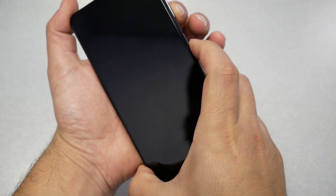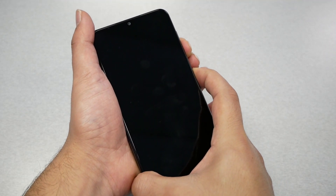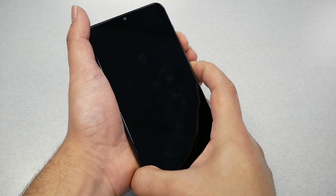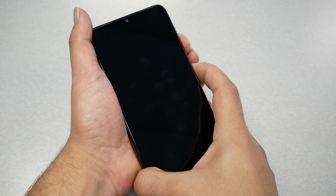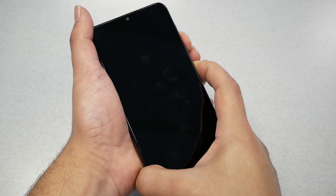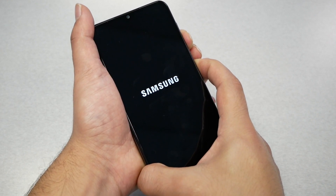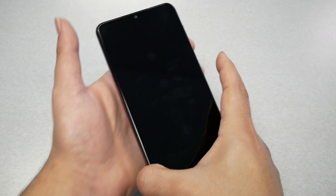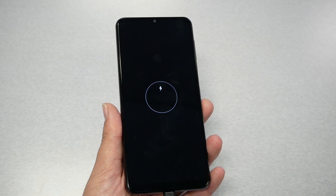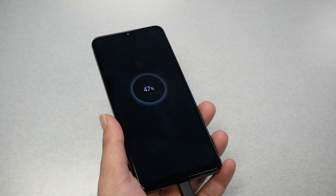Once the phone is charging, use the power key and the volume down key — press and hold until the phone restarts. Even if the phone restarts and vibrates in your hands, keep holding power and volume down until you see the Samsung Galaxy logo. There are two logos that appear: the Samsung logo first, and then the Samsung Galaxy logo. Wait until the Samsung Galaxy logo appears and the phone shuts off. Once you see it, remove both fingers. Now you can remove the cable — we no longer need it because the phone is completely off.